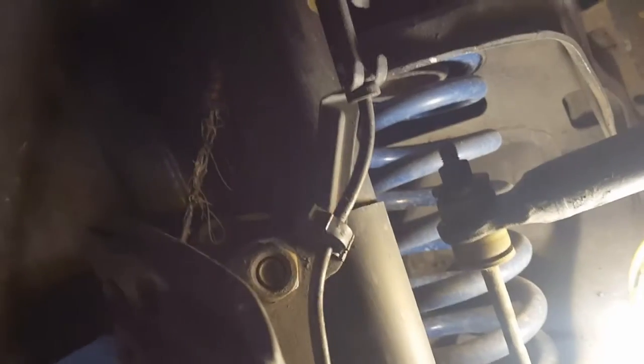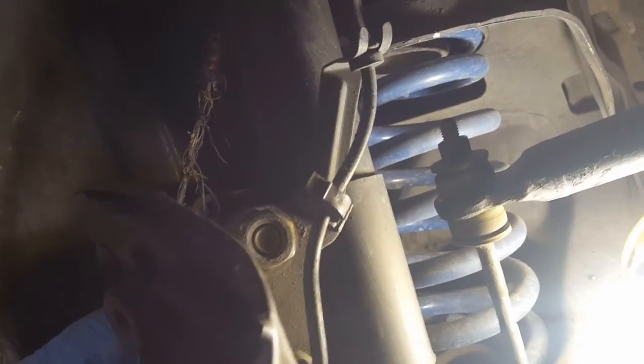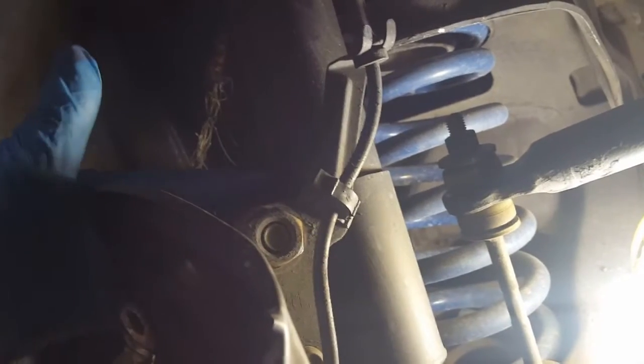But before we get into that, we have to take loose the shock strut, or the strut, which I believe this side is a 7/8, this side is 15/16, and the bottom is I believe a 7/8 also. You take this strut loose from here, and then you got to get a little star wrench for the ABS to pull that loose. So when this A-frame drops, it doesn't break this ABS. So that's what we want to take off.